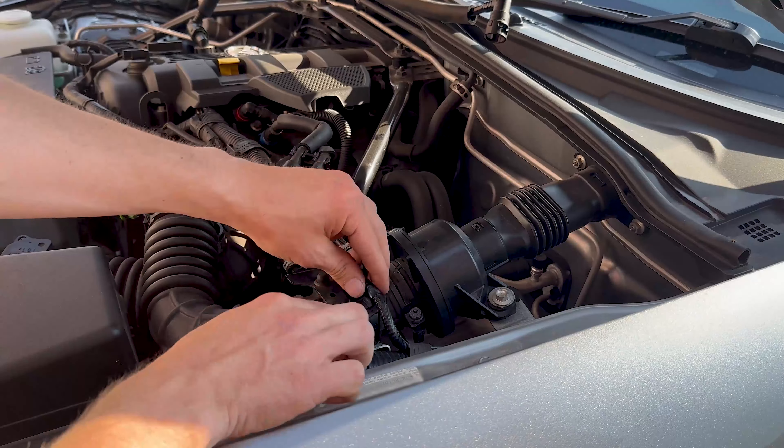All you're going to need is an intake pipe from a pre-facelift MX-5, and also — this is not always needed — the vacuum pipes that you find with the sensor, because they're a little bit different lengths, but we might not need them. You can pick them up for around 20 quid. The tools you're going to need are a 10mm and a Phillips head.